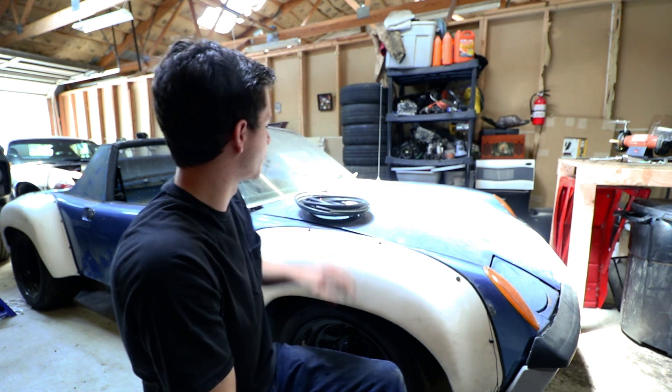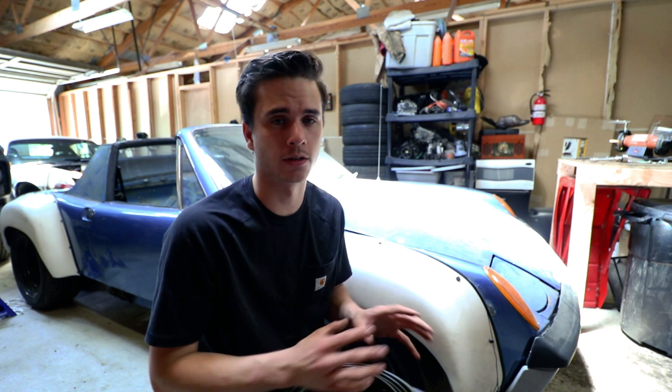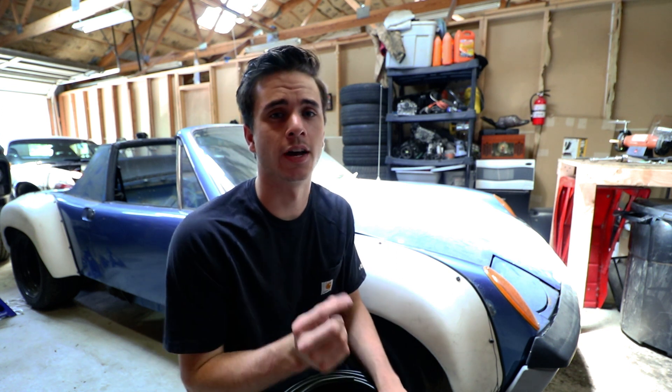That's why I've been working on other stuff, but before I can really get this thing tuned, I'm having issues with the fuel system. The factory fuel system in the 914 is fuel injected, so it's all set up right with a return line and everything, but the lines that they use are these really brittle plastic lines. They're actually like a clear plastic tubing and they're garbage, so I keep springing leaks in my fuel system.